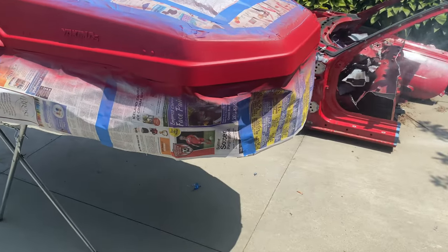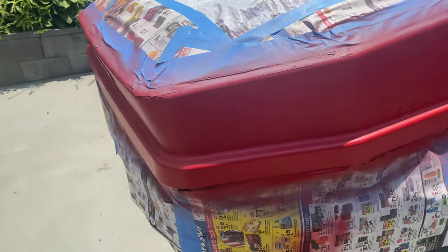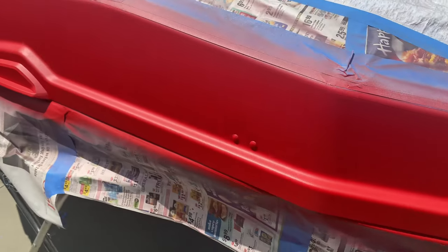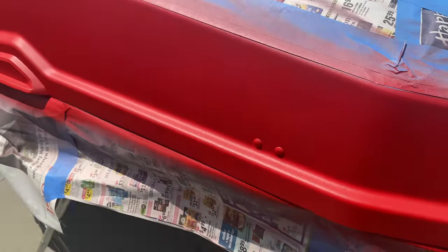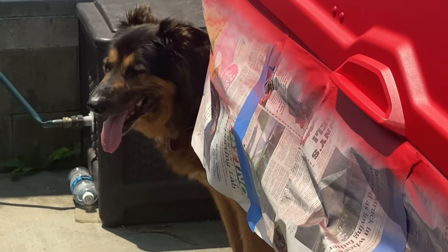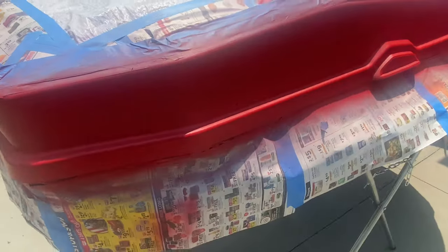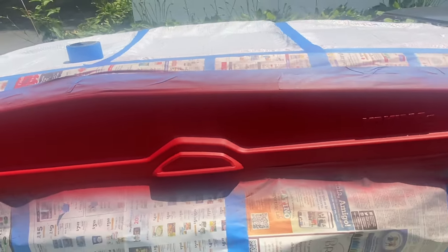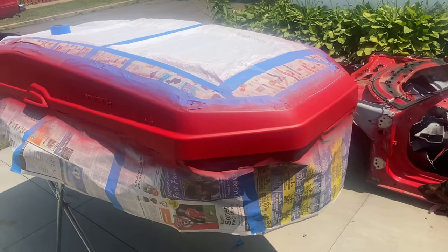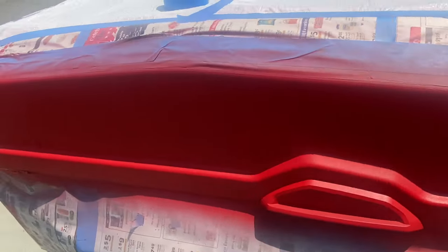So I just painted it with a Mitsubishi red, and that was to first dust it. Then I went over with a different red I had that, if you hold a color chip up to the car, it matches, but then when you actually spray it out, for some reason, it's a slightly different shade. So I'm gonna finish it off with an actual matching color, the two that I sprayed out yesterday, one of those two. I still haven't been able to decide which one's a closer match. Neither are an exact match, but they're both very similar.